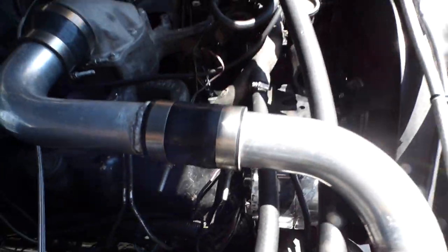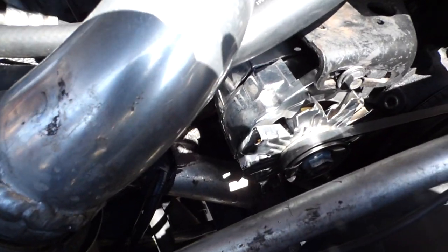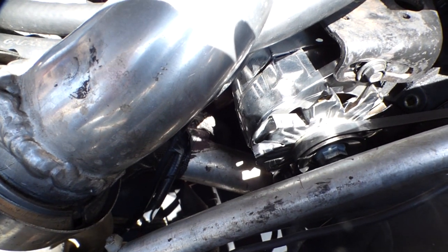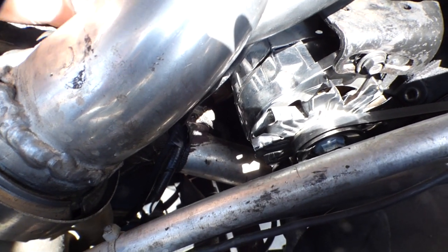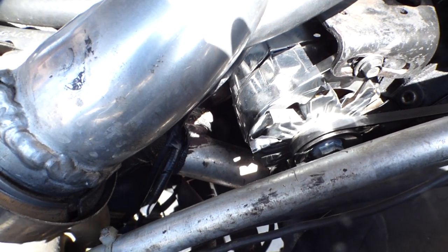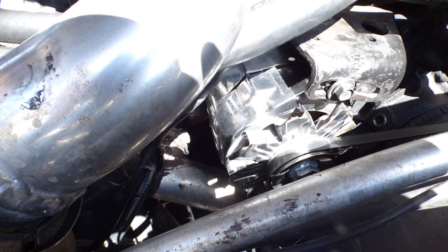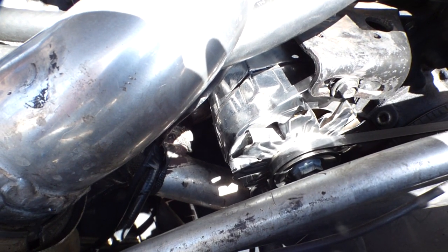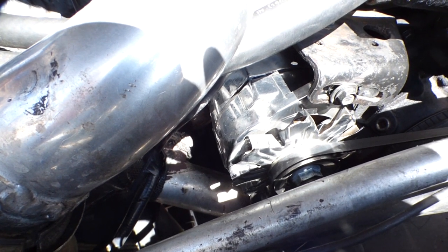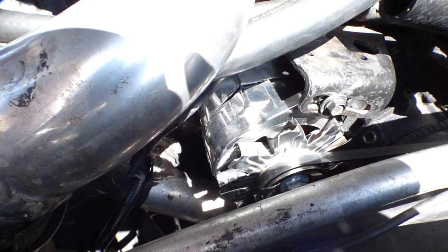All right, so that lift pump is way down there underneath all of this maze of crap. So to get to it, I had to remove the alternator, I had to move some of this other stuff aside. Of course, you have a hard fuel line and then a soft line to that fuel pump, a few bolts. You got to take out the plate as well, because your fuel pump push rod will fall down and you'll never get it back up without removing the plate first. Use a little bit of heavy grease to hold that fuel pump back up when you reinstall. Okay, that's an old trick, not a big deal.